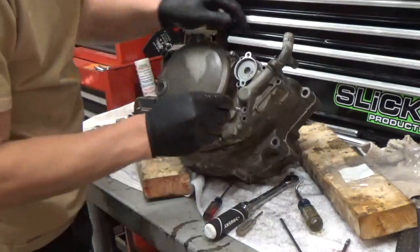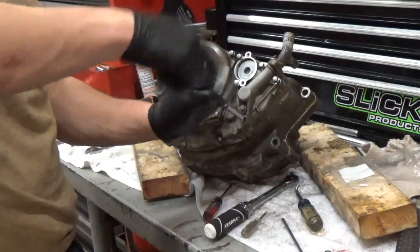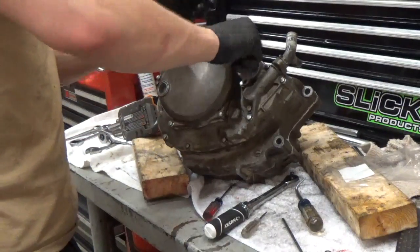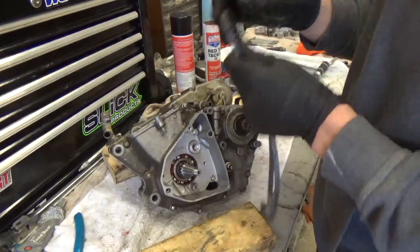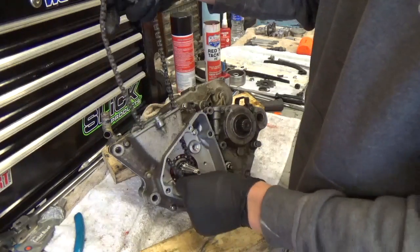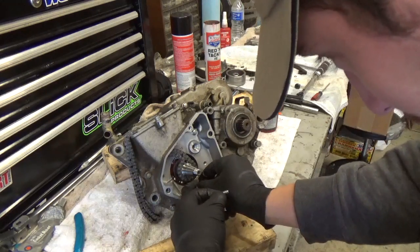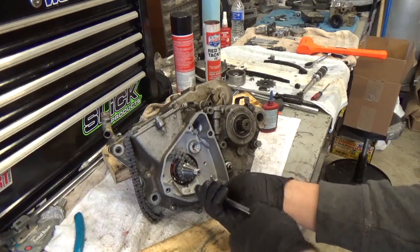Then install the water pump cover with the gasket on the other side. Install your three bolts and drain bolt, hand-tighten those, then lightly thread all of them in a crisscross pattern. Then install your oil filter cover. I tighten those bolts hand-tight first, then fasten down with the ratchet. Next we can install the timing chain on the left side of the engine, putting it around the crankshaft. Put loctite on the bolt and install the timing chain holder in place, tighten that hand-tight, then ratchet it down.